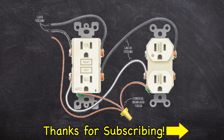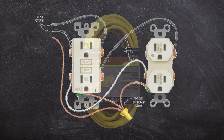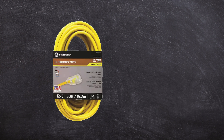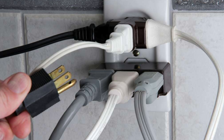The other important consideration is the length and gauge of your outdoor-rated extension cord. This cord runs from the outdoor outlet you've plugged into to the inlet on your van. Make sure it is rated to carry the amperage of the circuit, and use the shortest extension cord you can. Use common sense and don't overload the circuit the same way you wouldn't overload circuits in your home, garage, or workshop.